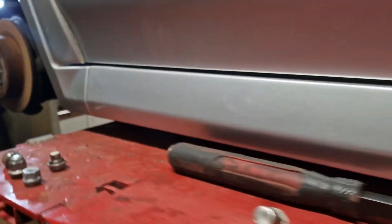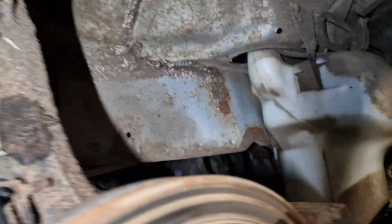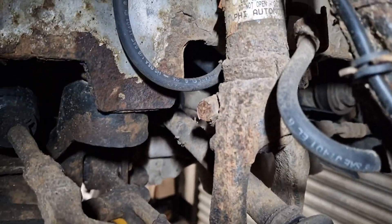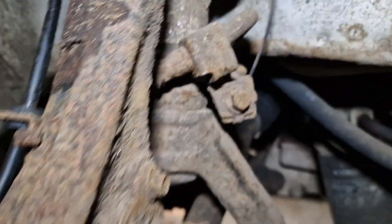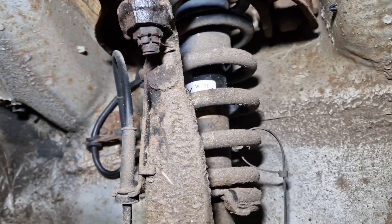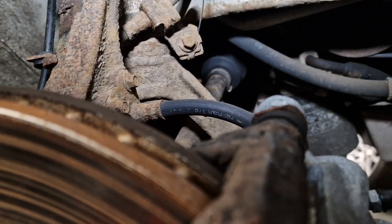Normally I take the fork off the bottom, but I'm going to do what the Honda boys do and split out that pinch bolt. It's looking a bit worse for wear. There are a couple of 10mm headed bolts to undo, and I'll probably undo that castle nut to give a little bit of flex on the hub to get everything out.